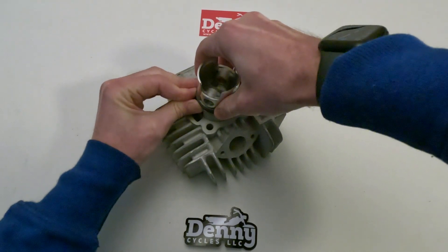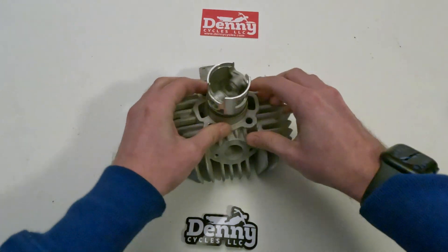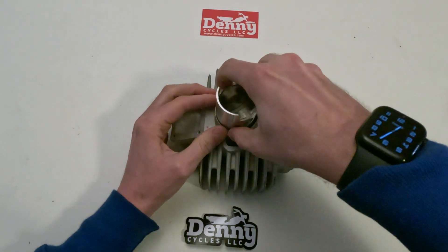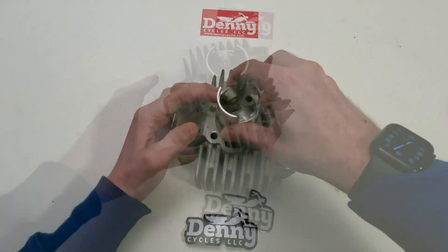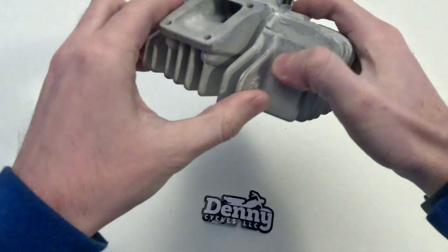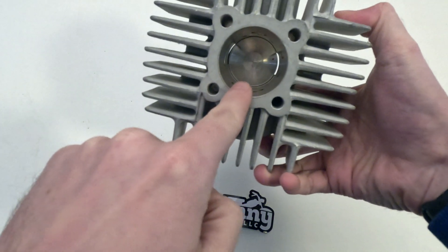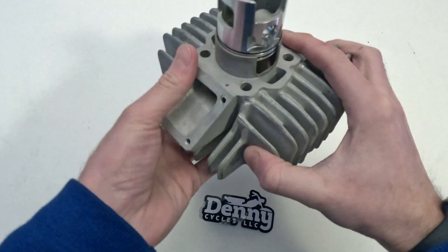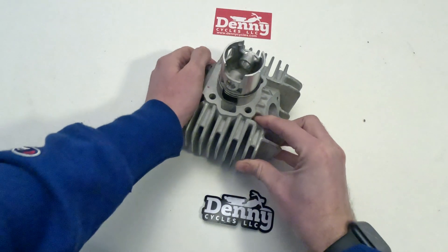You're just going to compress it with your hands and push the first piston ring in — no pressure, no force at all. These are fragile and will break. I'm going to cut away here to show you again how to get it lined up. You want that arrow to face down to the exhaust, and that cutout will face up to the intake.